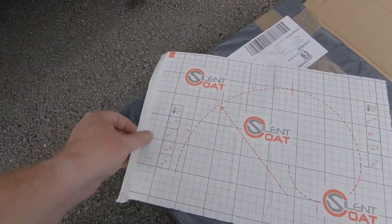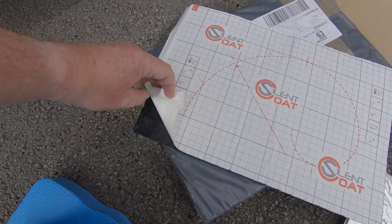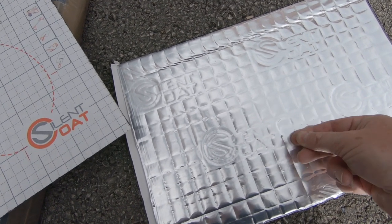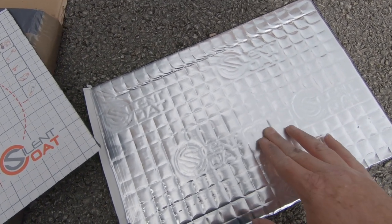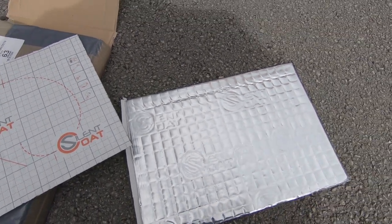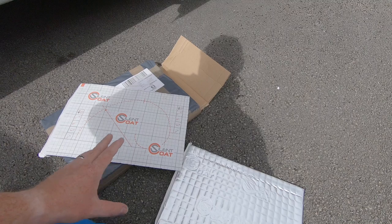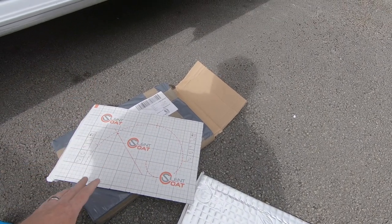The back of it is just peel-off and very very sticky, and the front is a kind of aluminium. You can tell whether you've done it right because you push down those little dimples as you're applying it, so you can see whether you've forced enough pressure in. I'm certainly not sponsored - other products are available. I used this because Mervy said he used it and his van is definitely much quieter than ours.